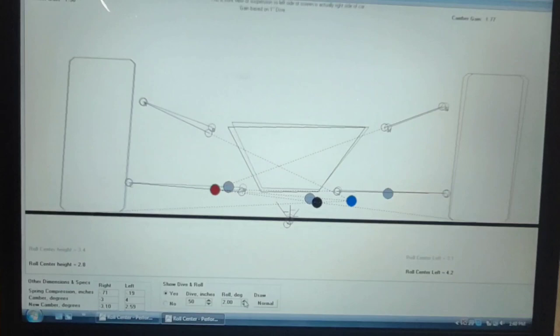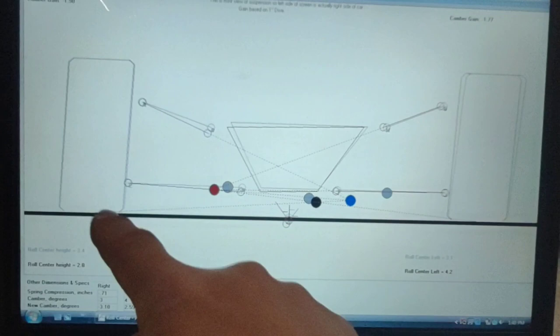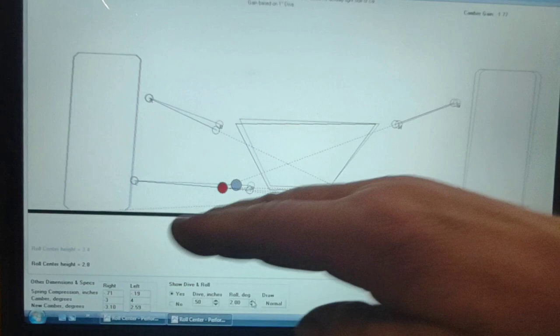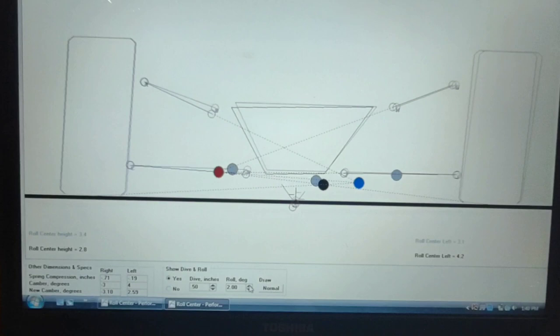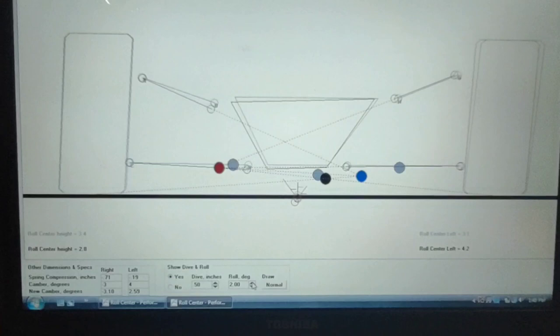This is why you look at all the cars, they land as flat as possible. They want to keep them as flat as possible to keep that roll center from jamming over to the right. What happens is the car starts to lean over and you lose camber on the right front. So if your car is sitting flat, you land and you've got, say, 6 degrees of camber on the right front, and you roll over 1 degree, you've just effectively lost one whole degree of camber on the right front. So getting the car to land flat on the sway bar, even if you have to raise the right side frame heights and change the rake in the car a little bit to do that, getting the car to land flat is a major, major benefit.